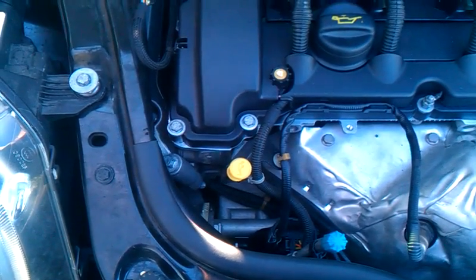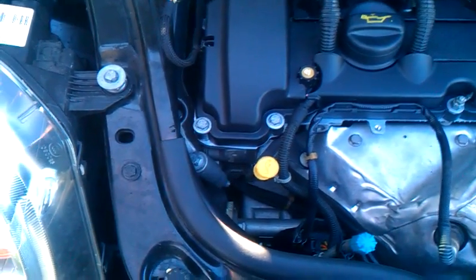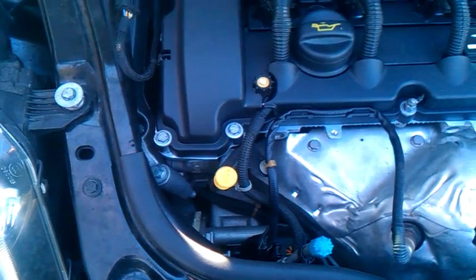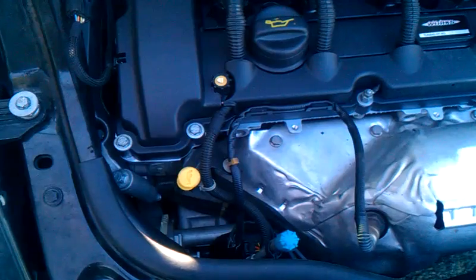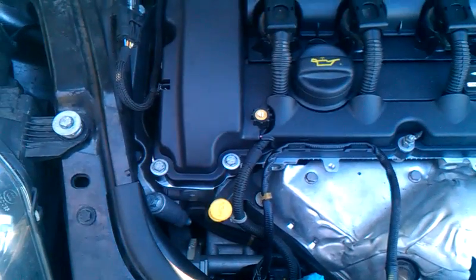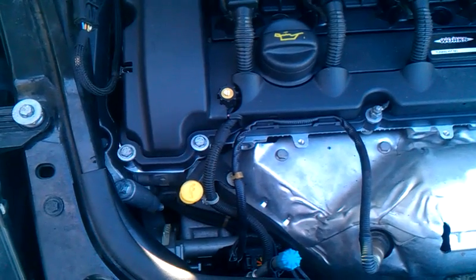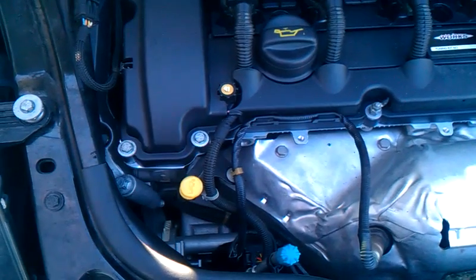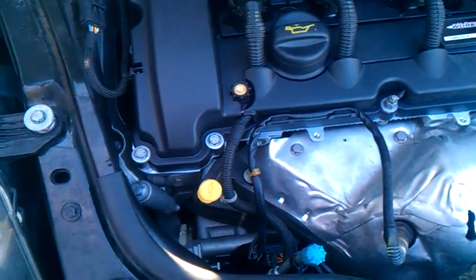Now, some of the older models, like this R56 Sport John Cooper Works Edition in front of you from 2008, it's got about 92,000 miles on it, and these engines are known for their issues with oil consumption. This one in front of you here burns about 1 quart every 1,700 miles, and for that reason, it's imperative that you check your oil every time you get gas, unless you feel like putting a new engine in your car. And I know that number sounds surprising, but I've actually had a mechanic tell me that for this engine that's actually pretty good. So, let's get on with it.